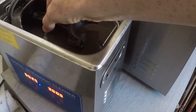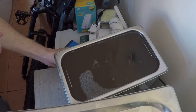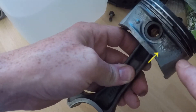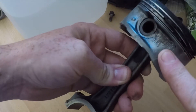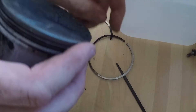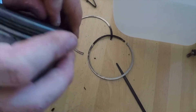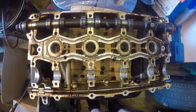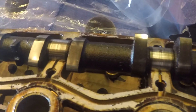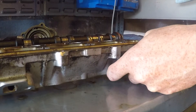Although it is scrap, Swampy has sonic cleaned it so that it's easier to see just how bad it is. Interestingly, this engine has got pistons from a 135, which is actually the non-VVC engine. Swampy's engine of course is the 160 brake horsepower VVC version. This engine certainly seems to be a mismatch of parts. There is a receipt showing a replacement head was fitted about five years ago, so it's possible that this has got a VVC head on a standard 135 engine block.